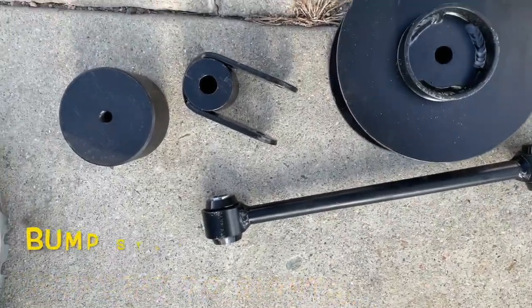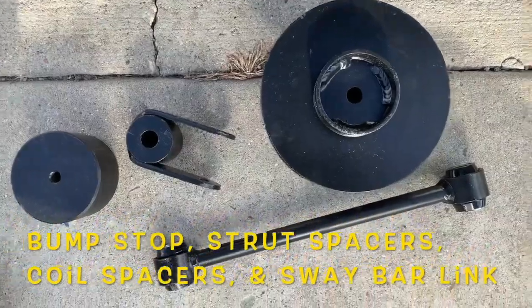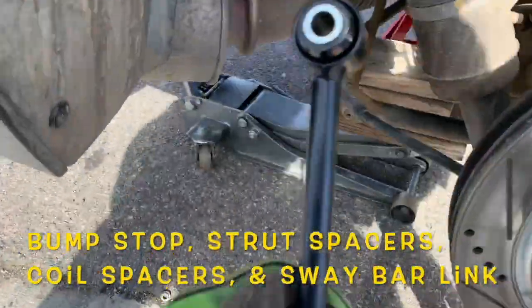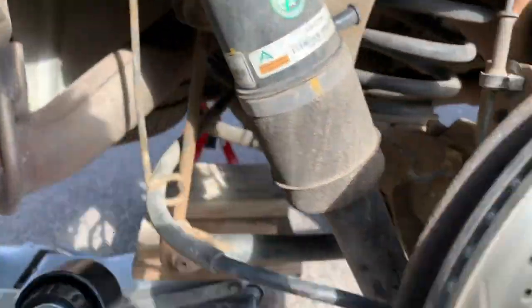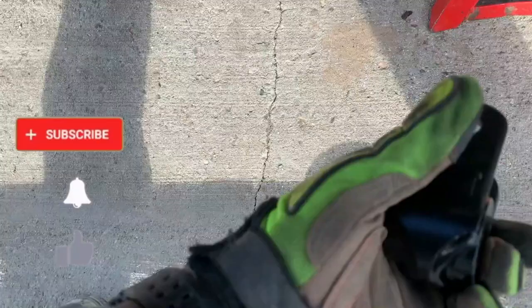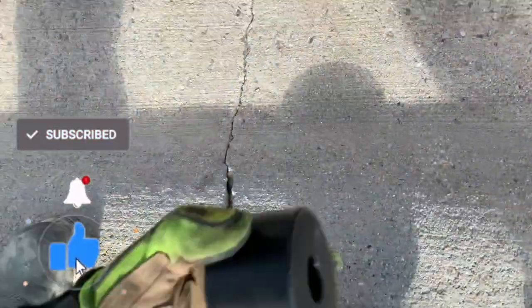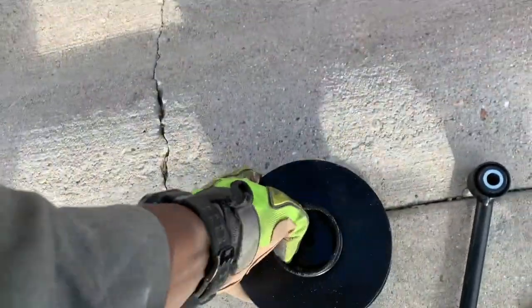These are the equipment that's going to be used for the rear. It's a 4-inch lift install. I'm just going to show you and make it easy. It's this way with our links. These that are here, remove them with this. You're going to put these spacers on your shocks. The bump stop here is going to go right here in the bottom. I'm going to drill an 11/32nd hole in the middle, put that in there, and then this is going to be a spacer for the coils.